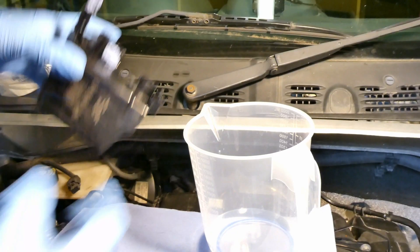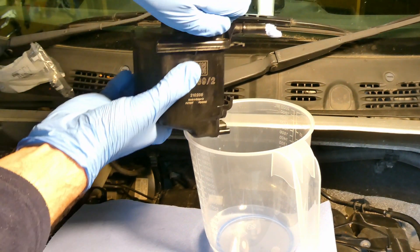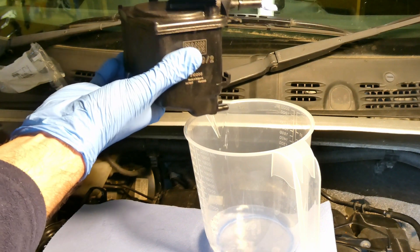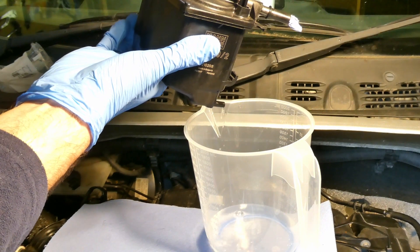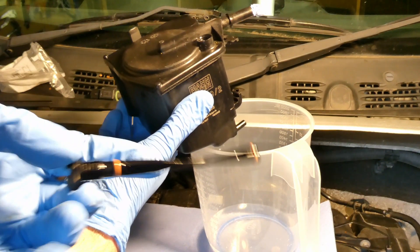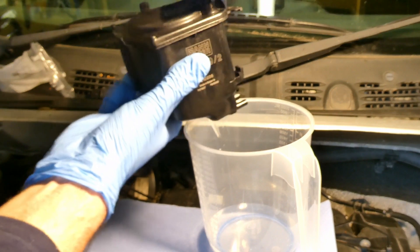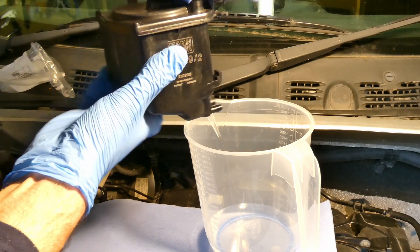Let's see what happens if I undo that valve. This screw is a bit tight. If you undo it — there you go, it starts leaking the water that was poured in the filter. Inside, there's a small piece with an O-ring at the top and an O-ring at the bottom, which seals it. You screw it back in again and you've purged the water from the diesel filter.